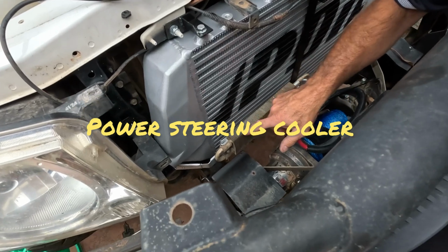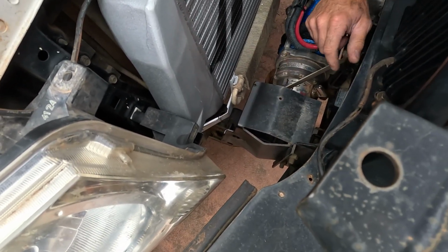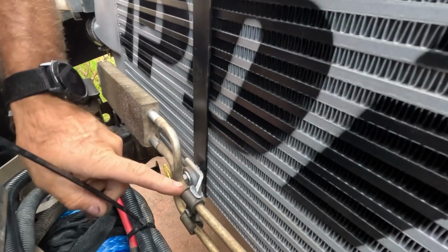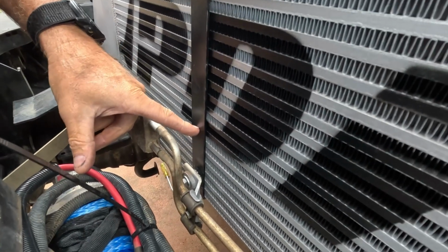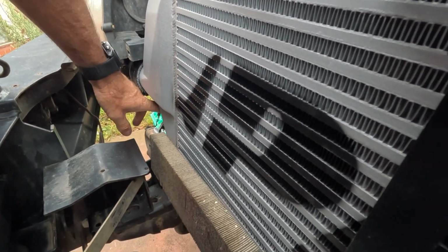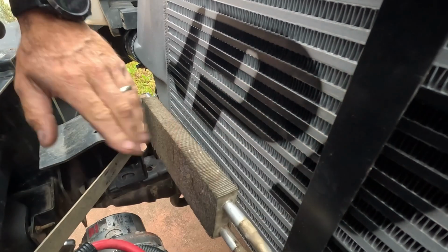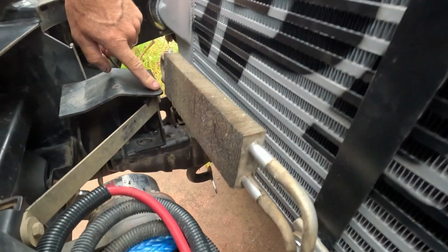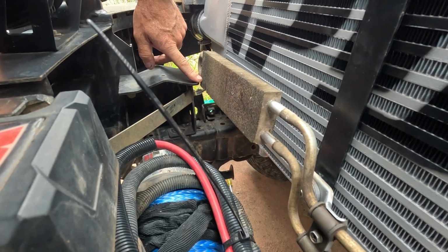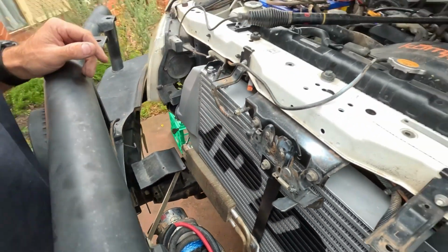Condenser pipe clashing with the mount on the bull bar. So we'll cut this one off, move it up, and then change the bracket down the other side here. We'll bend and change that, and we'll get that up a bit higher. It's only got to go up 20 mil, and that'll clear that. And then hopefully we should be pretty right. So we'll go ahead and do that.